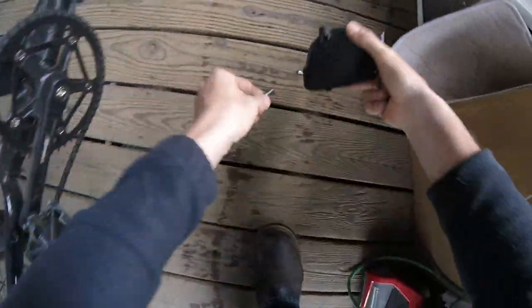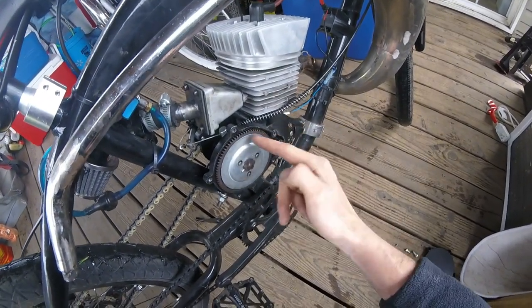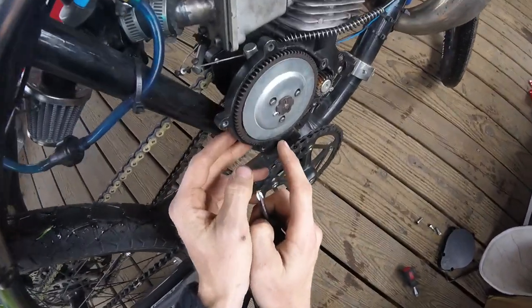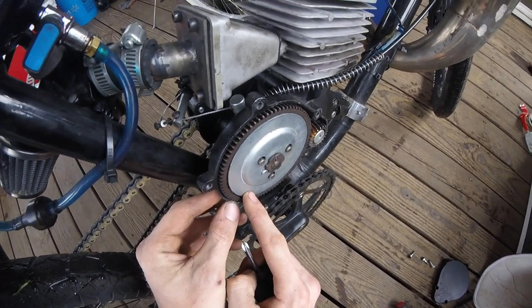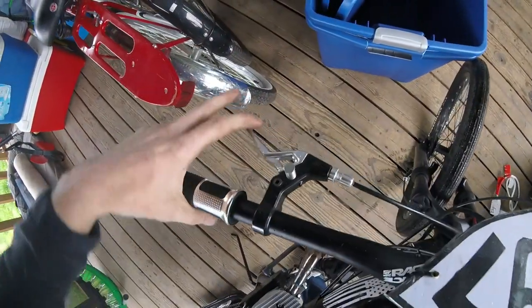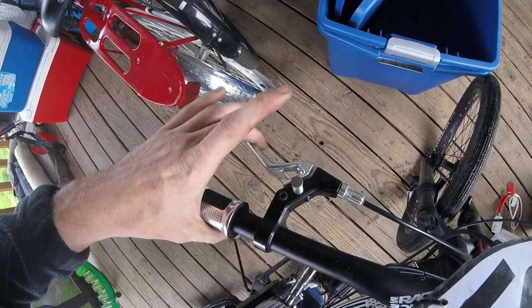Now we're at the gear, the pressure plate, locking screw, butterfly nut, and all that - I'm gonna grab a couple tools. I'm running red pads in here. I'll show you something quick: you can see there's just a little bit of motion there, which lets me know my clutch is completely released. You can see there's just a little bit of play there - that's what you want, just the slightest bit of play.